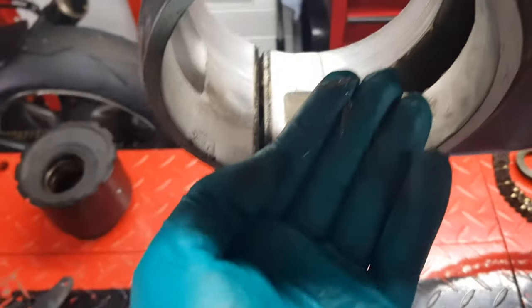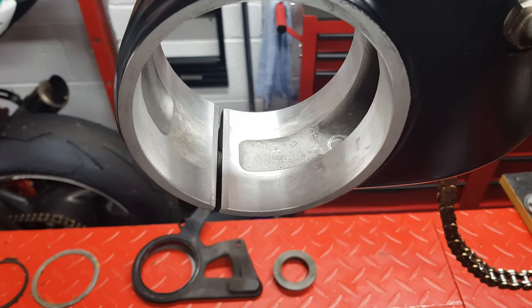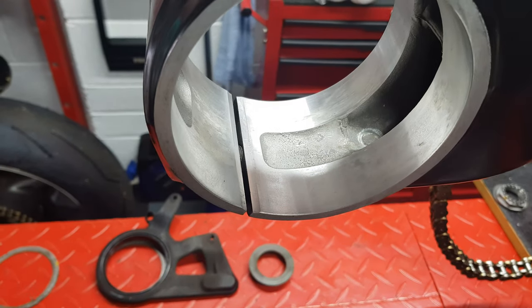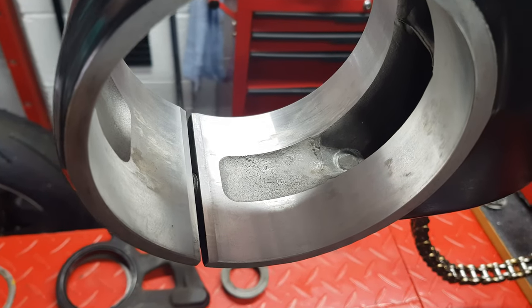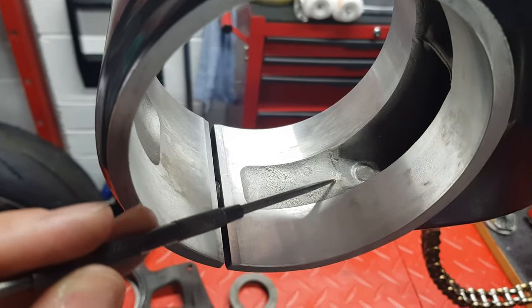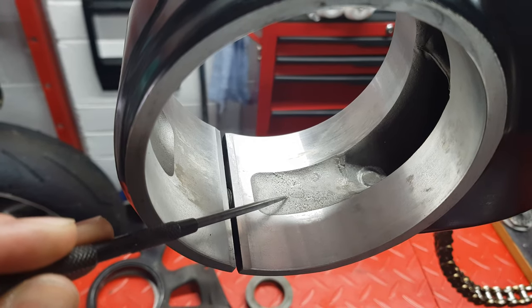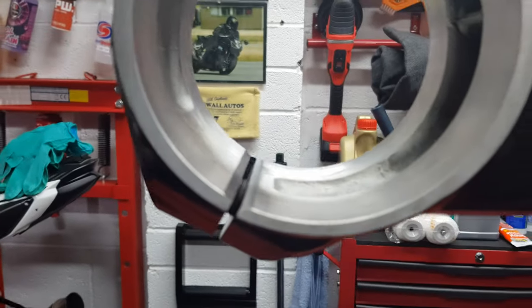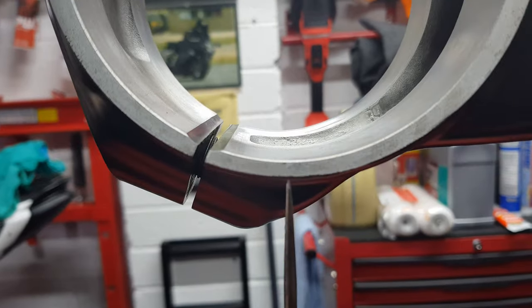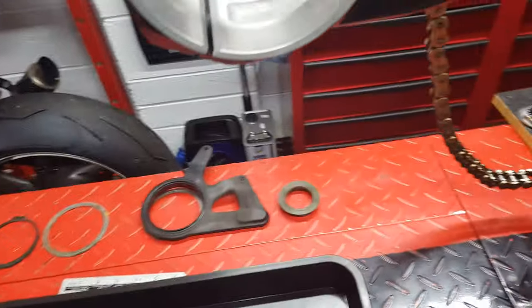So I've cleaned the inside of this. As you can see on the Gen 1, water catches here and just builds up, rusts the inside, and knackers up the bearings. What we need to do is work out roughly where to drill — I think it's going to be about here, a 3mm hole. This seems to be the lowest point, but if you drill here you are drilling into the threaded area for the bolt, so it's going to have to be about here.